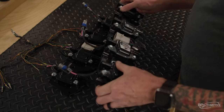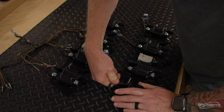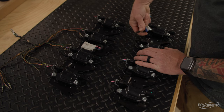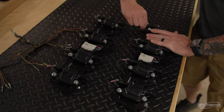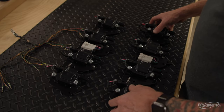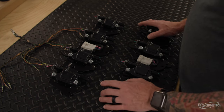So red will always be on your right. On your driver's side of the engine, purple will be at cylinder number one, which is the very front cylinder on your driver's side. So it will be purple, light blue, green, and then red. The easy way to remember this is red always goes on the right and green and red are Christmas colors — that's just the easy way I remember it — so you always know that your red is on the right and that the red and green will be together, and then purple and blue will always be together on that end.